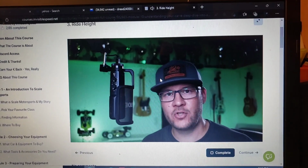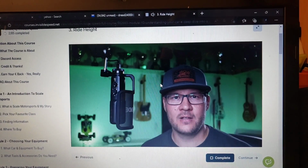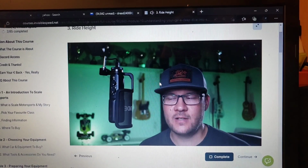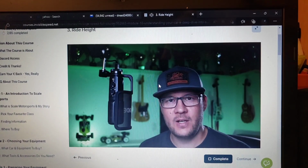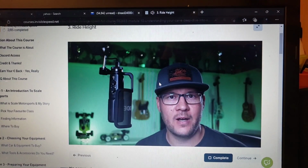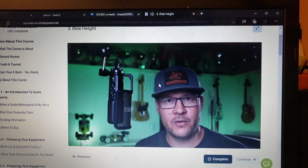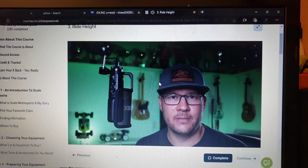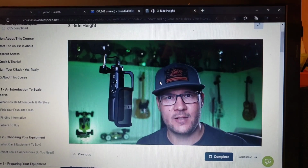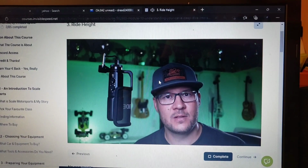Also, as I already mentioned, everything is tuned and adjusted to a set ride height. So if you do make big changes in your ride height, if let's say your home track is really bumpy and rough and you've found that running 29 ride height front and rear is the best, if you then go to a high grip smooth track where normally a ride height more like maybe 25 front, 27 rear is better, when you do that, you actually need to readjust some things.